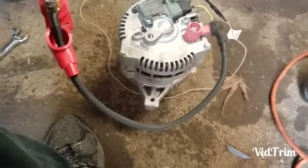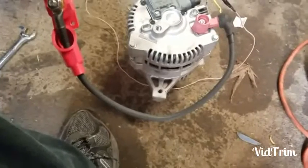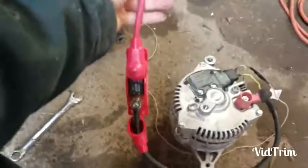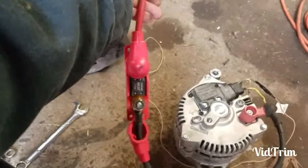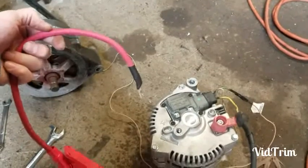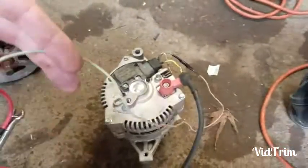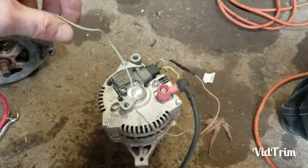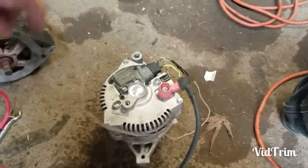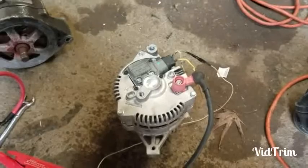Then this goes into a mega fuse. You can see this line is black and that one's red — I could have spent $10 per wire, but I spent $10 for both wires and it was enough. I've got a 175-amp mega fuse here in the middle, then I'm going to bolt to the firewall, and then this just goes back up to the solenoid. This green with red wire — I found a matching one in a motorcycle wiring harness — goes back to the wire in the truck. So basically it's a two-wire hookup. Simple.